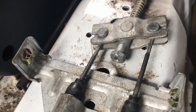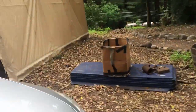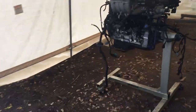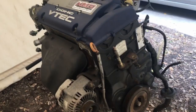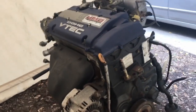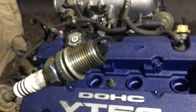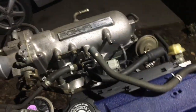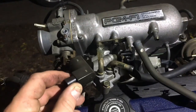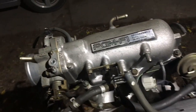My adjustment was quite far out actually, but yeah I'm really happy — can't wait to test them out. There's a lot more to do before that can happen. Coming over here to the motor: I have to pull off the wire harness, take off the plenum for the intake manifold, take off the parts I don't need, and get ready to do timing, spark plugs, spark plug wires, things like that. I just looked a little closer and the head is stamped PCB — you can see that upside down. The idle air control valve is completely different than the OBD1 control valves — it's got a completely different plug. So that kind of sucks; I won't be able to use this plenum at all.